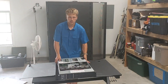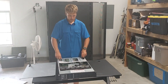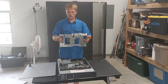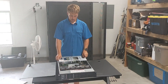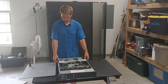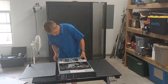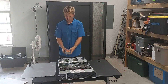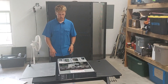It is rocking all of its RAM — beautiful inside. On the back side, because it's a 2U, you lift these up and it pops out — that's your IO. We've got a single quad-port gigabit NIC and dual single-port gigabit NICs, or 10-gigabit NICs. This one is the one I have the hardest time closing back up because she's a bit finicky. She's old, she's angry. Comes with dual 750-watt power supplies — beautiful orange. Everything on this is supposed to be tested, good, and working. It has its RAID controller cards still in there, so it should be a good set. I can just run it as non-RAID.